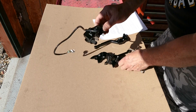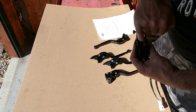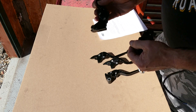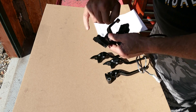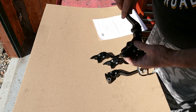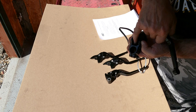This is a lever perch off an Interceptor and it has the clutch switch mounted inside the lever. The special mountings we've had machined up have a little ramp on here that contacts with this switch, and obviously when the clutch is pulled in it presses on there.